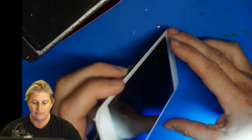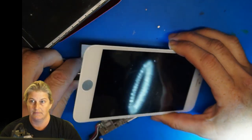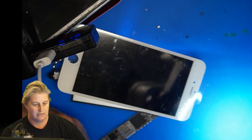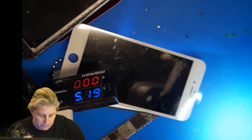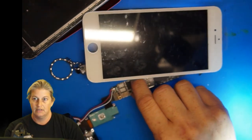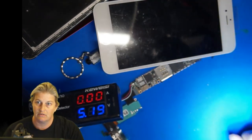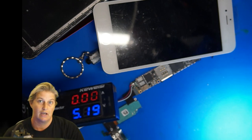Let's prompt the phone to boot. We can prompt it to boot two ways. Since this phone doesn't have backlight, I'm going to put a flashlight under here. We can prompt it to boot by plugging it into USB — so here is our USB ammeter and let's see if it responds to a prompt by USB. I'm going to plug that into the dock connector. I see no current consumption and nothing on the screen — it's as if it didn't have a charge port at all.